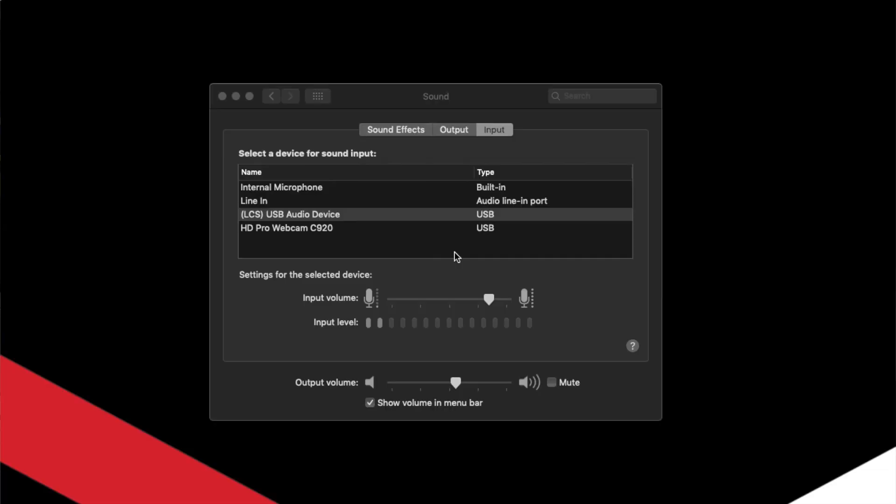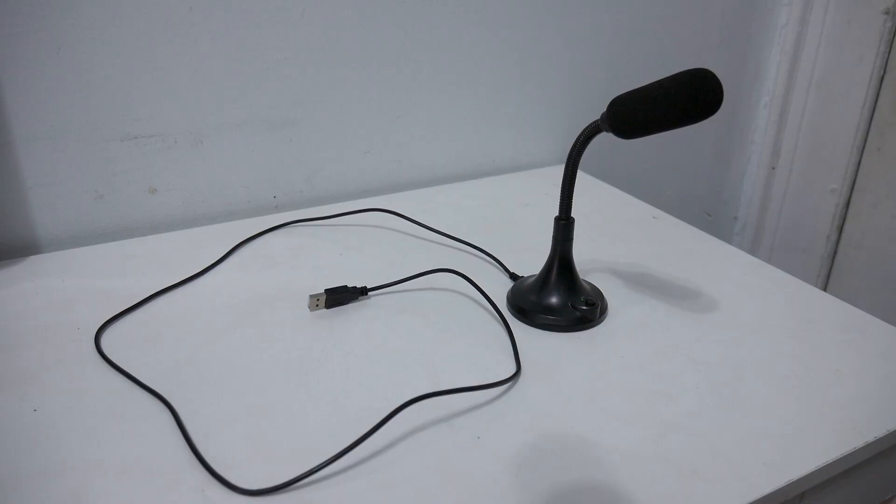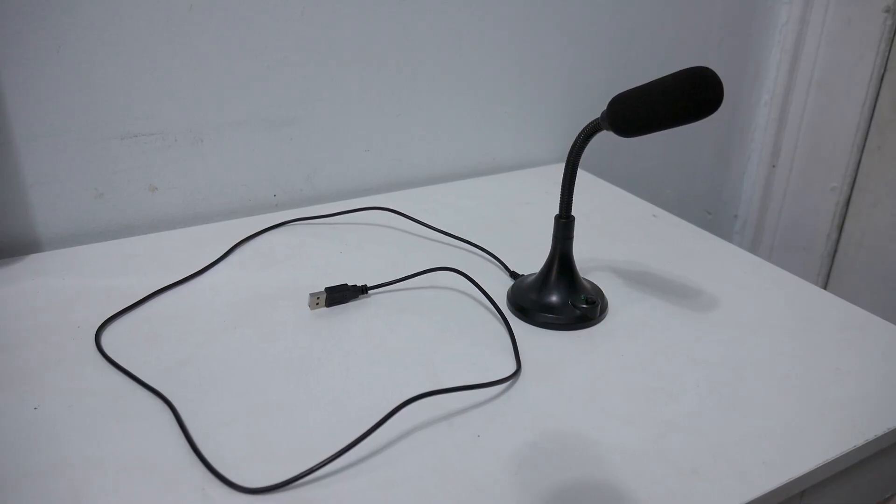Since this is a condenser microphone, if you are planning on using one of these cheap microphones, I highly recommend you lower the microphone level. I use this microphone at level 80 and it works perfectly. If you cross like 85 to 90, you will hear a little crackling noise, so I highly recommend don't cross 80 — 85 max, don't cross 85.